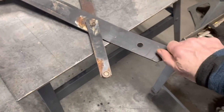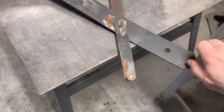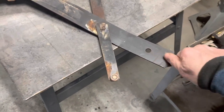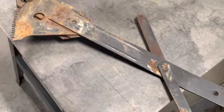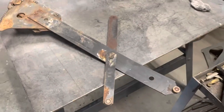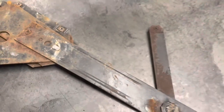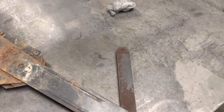What I'm going to try to do — these are put on with a stepped rivet, so I'm going to cut the back of the rivet off, take the roller off the little shaft, clean it up, get it to roll, stick the rivet back in the hole and put a spot of weld on it and see if it'll stay. I've done that before. I've tried soaking these things — that one's turning out pretty good, this one's turning okay, but I've soaked it multiple times with penetrating oil and it's just not getting there. There's too much crud in it. But this one won't turn at all, so let me get my grinder and whack the back of that rivet off.